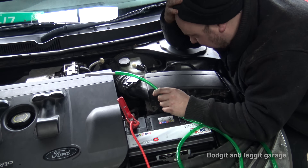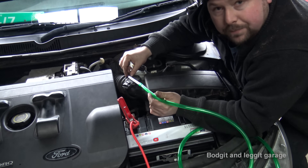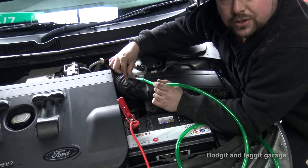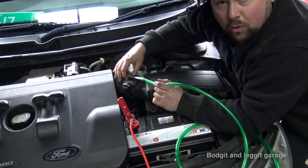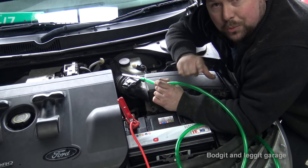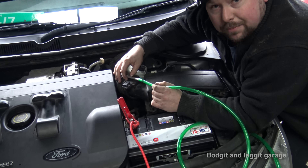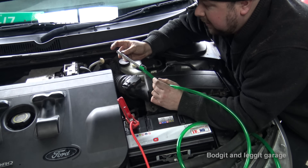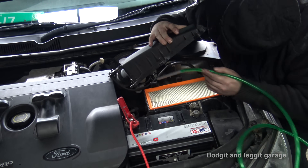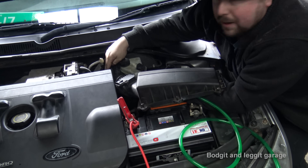One thing I've noticed — and Godfrey who sold me this confirmed it — when you see people on YouTube who disconnect the intake pipe and shove the hose in, they tend to put tape over the gap they've created. Don't do that. When you rev the engine you could suck water through the water trap and you don't want that. If you shove the hose down the pipe and there's a little gap, don't worry about it — it's not going to be an issue because it's still pushing the hydrogen through into the engine.